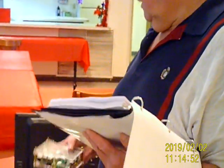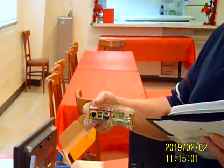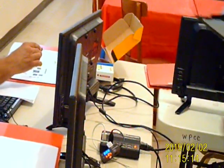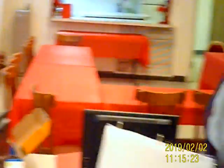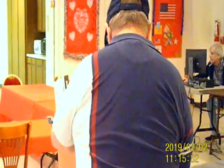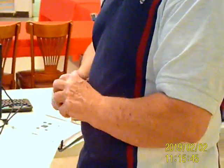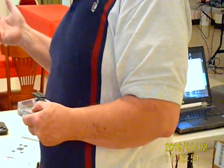The audio jack is here. It also has composite output — it's a four-pin audio jack, so you can get composite plus audio out of it. It's not stereo, or you can have the audio come out through your TV. It has a camera serial interface — you can attach a camera to it. I have a USB camera at home that takes a picture every minute of every day, 24 hours a day, seven days a week, and it stores it on the USB flash drive.